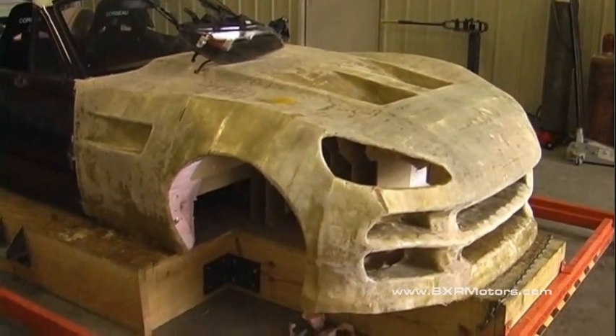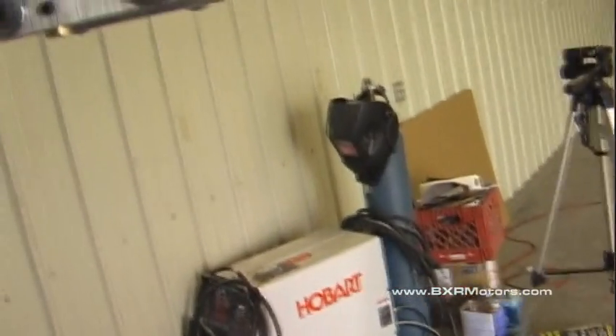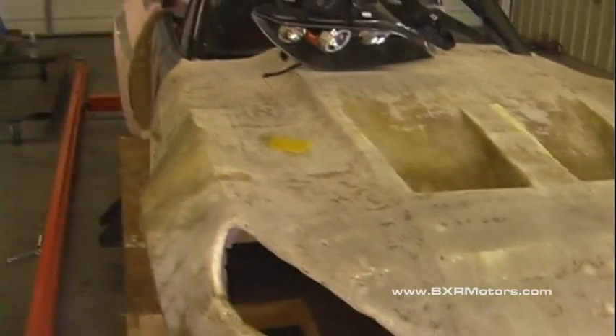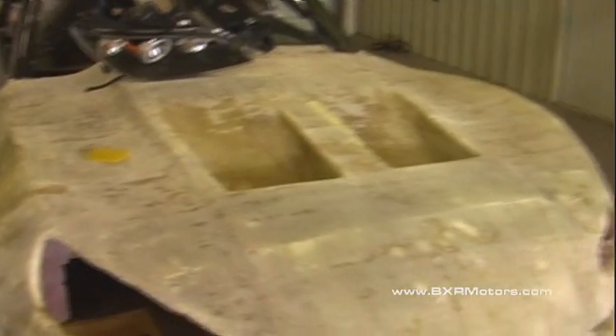Anyway, I'll try to cover the gantry setup and the lasers. Here's the gantry deal over here — we have a bunch of these mounted, and there's a laser stuck in here that's adjustable. You can tighten it down and there are screws in this area that allow you to pivot and adjust the laser to get it tracking right. Those lasers basically go down the whole length of the car in an X pattern, and they allow us to keep the symmetry correct throughout the whole car when we're working on it, adding fiberglass and building up materials. So I'll cover that more in the next video — until then, see you next time.